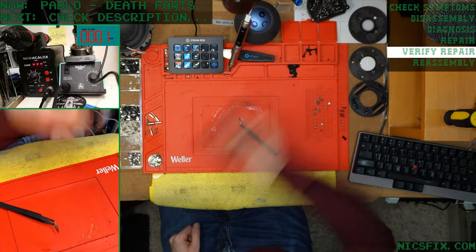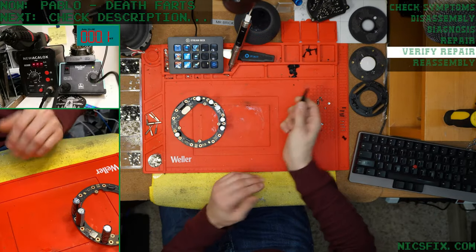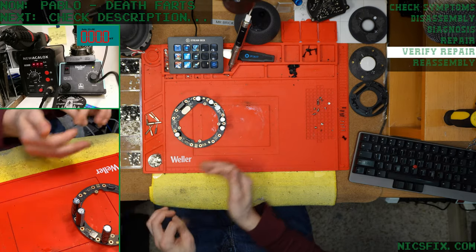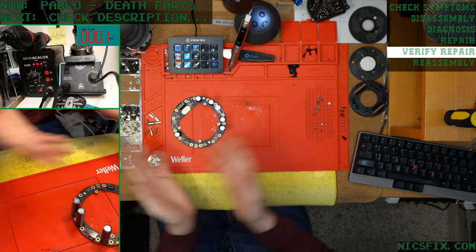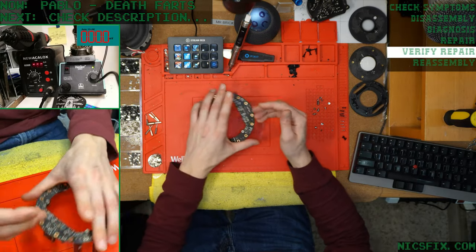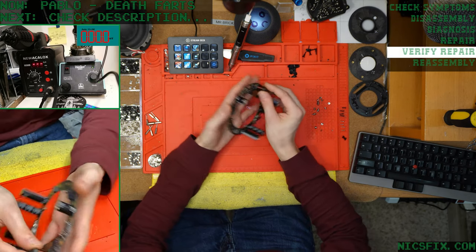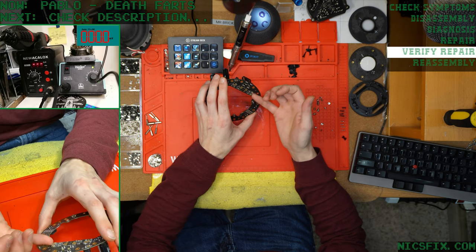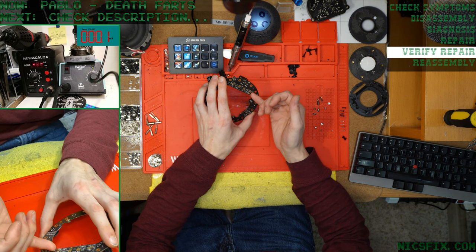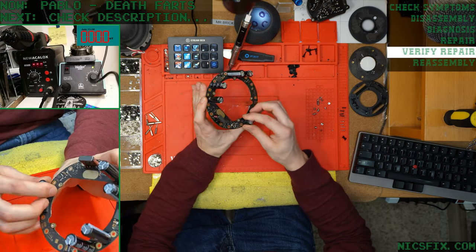And there's only four of them. I would replace all four of them at once. If you're trying to figure out which one of the four are bad, don't even bother. Just replace all four of them with the same part, like a brand new capacitor, all four of them. Don't go mixing and matching them together, because these are filters. You want to match them all up. If they're in series, I'm sure it won't matter as much, but if you've got two sets of caps, each in series, but each cap pack is in parallel, then you might potentially throw things off there.